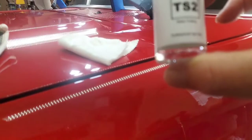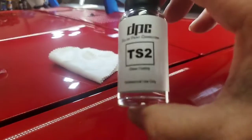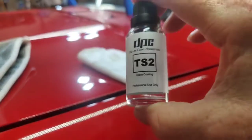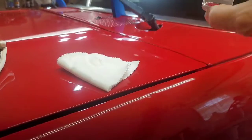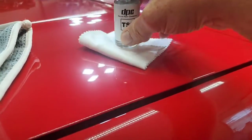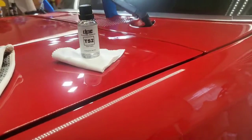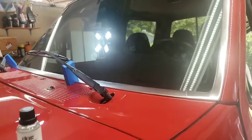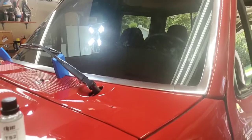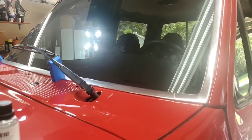The titanium — that's what the T stands for — the titanium glass coating. It is designed specifically for glass. You can put regular ceramic coatings on glass, but they're very difficult to work with because that's not what they are engineered for.